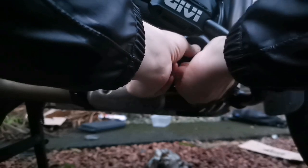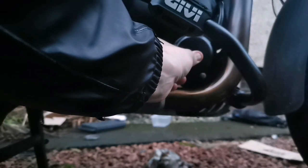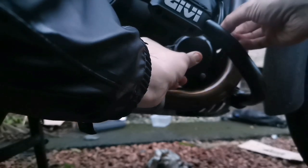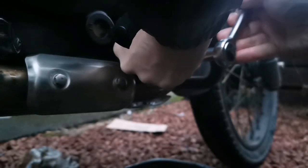Now just make sure you're super careful with this. You don't want to thread these bolts. That's a disaster. Especially on an area like this, you know, where you're having to do regular oil changes. A bit of anti-seize on there. Don't run one in and end, try and do the other two. Just work them in nice and even.